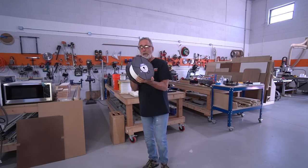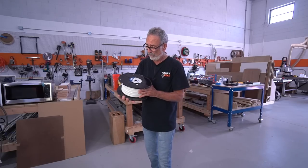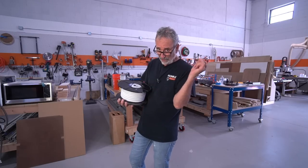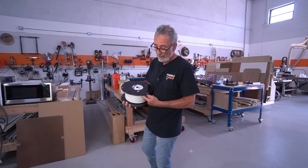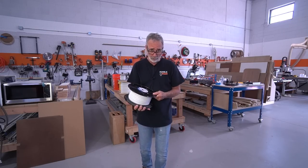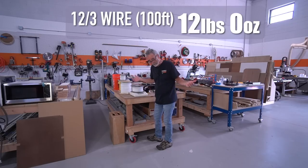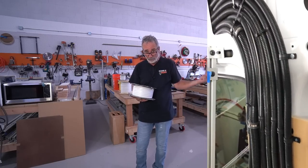Wiring. This is 12-3 Ancor stranded tinned wire — the best of the best, it's all I use. 12-3 is typically used for 120-volt runs, 20-amp circuits. I would also use this if I needed to send a DC ground — if I need to send three wires somewhere, get a ground over there as well, and a switch leg, I'd use 12-3 and mark it accordingly on the ends red and black. This is a hundred-foot roll and I easily go through a hundred feet — probably closer to 200 feet — of 12-3 in a single van build. This one roll weighs 12 pounds.